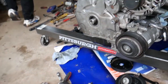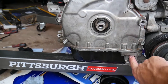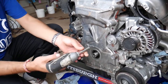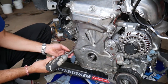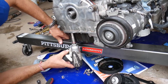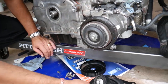Now we need to remove all the bolts on the timing cover. Start with the 10mm bolts first — there are several around the perimeter including a few on the oil pan. You also need to remove the bracket for the AC compressor, because underneath it there is a hidden bolt. Remove the bottom bolt on the AC compressor bracket with a 13mm socket, then the three bolts holding that bracket to the oil pan, engine block, and timing cover.